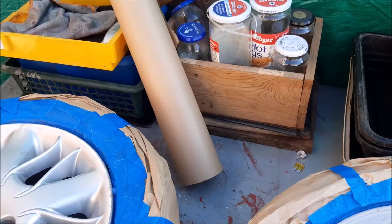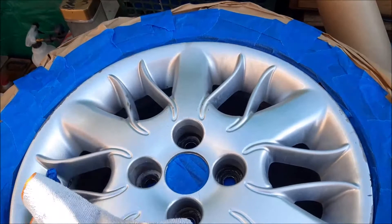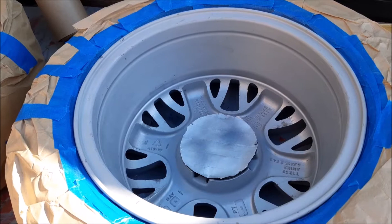They last years, so they're a lot easier and do last a long time. All we do now is just wipe these over with a bit of panel wipe - we've scuffed them up to give them a rough finish, then it's just a case of wiping panel wipe all over to get any grease or dirt off. We never used to use panel wipe, but since we've used it we've really found it useful - the paint works well and doesn't seem to initially react when we spray it.